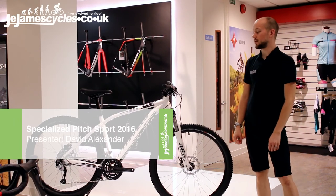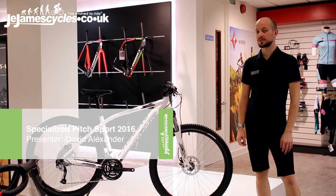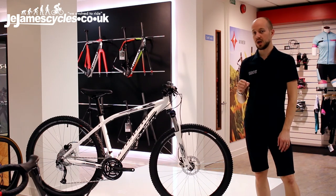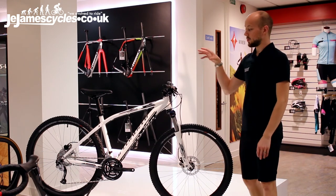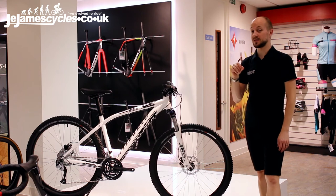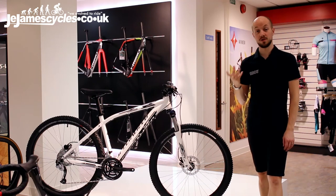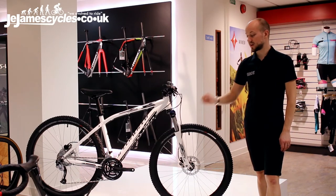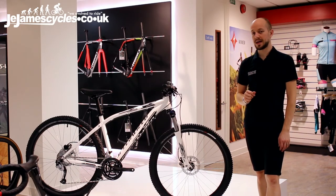The Pitch Sport here is our off-roader — this is a genuine mountain bike. The frame is highly manipulated for an off-road experience with a lower top tube for standover, and we also have the ability to take a rack on the rear for utility purposes. On the front end we have a suspension fork with 80mm of travel with multi-circuit damping.